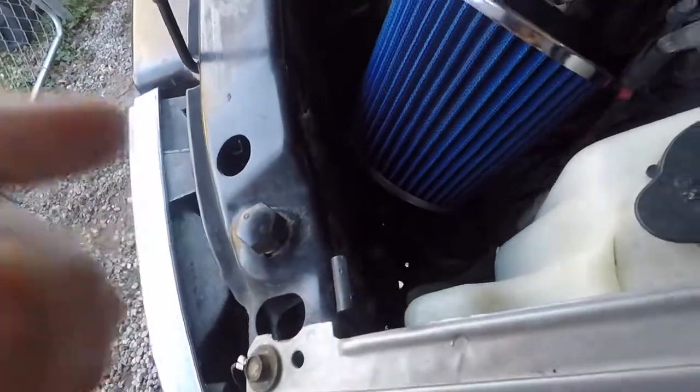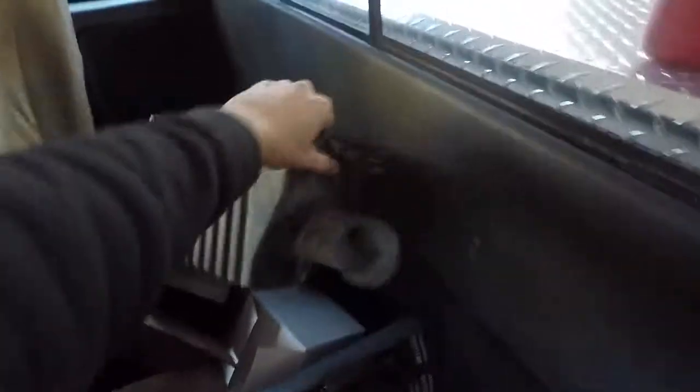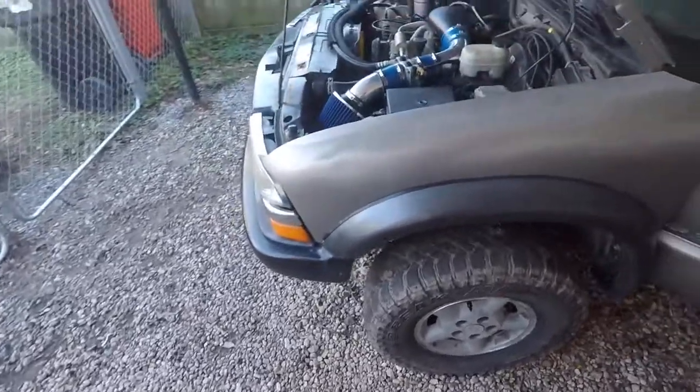One of the things I'd like to point out: if you've ever seen the original air box, there's a little hole right down in here. The factory air box has kind of like a scoop that runs through there — it has a little scoop so that when you had the filter in there, it runs right through the hole. Air gets behind the headlight, goes through the air box, and that's it. Some say you don't want to take the factory air box out because it takes down the efficiency of it.